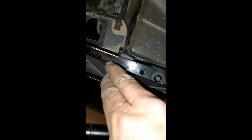Just put all these clips back in — everything back in reverse order. There's a row of bolts across the bottom of the bumper — little 7mm screws. The worst ones are putting back in. There are two 8mm up here and one 7mm. On the passenger side, the 7mm is difficult with the washer fluid tank right there — it's really tight. Just gotta tighten up the ones across the top here to hold the bumper in, then put that splash apron back in and put this row back on. Before I put the splash apron back in, I'm going to check the hood fitment.